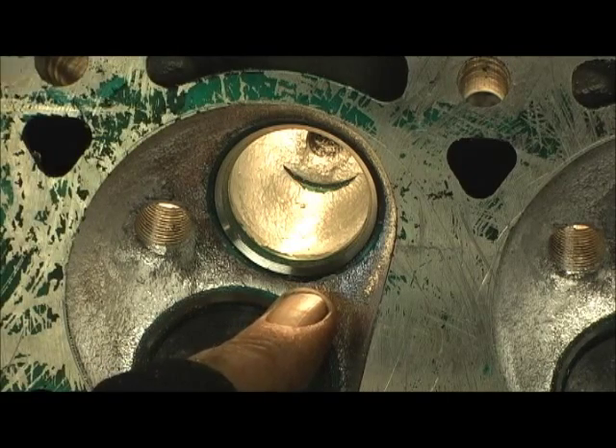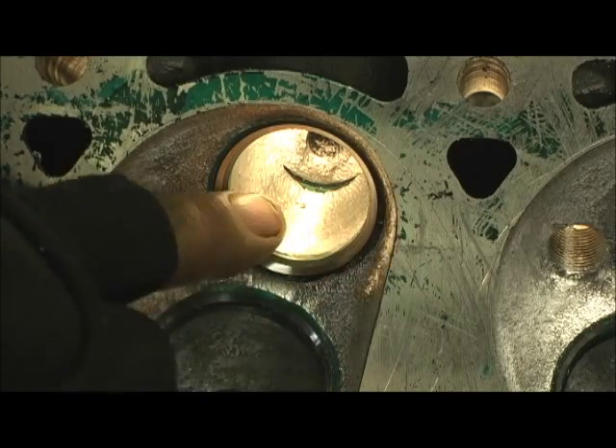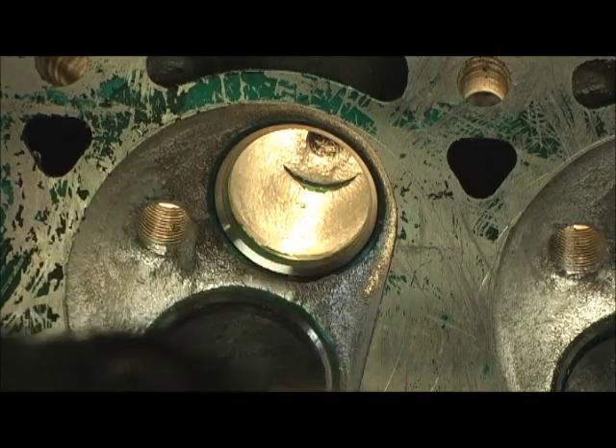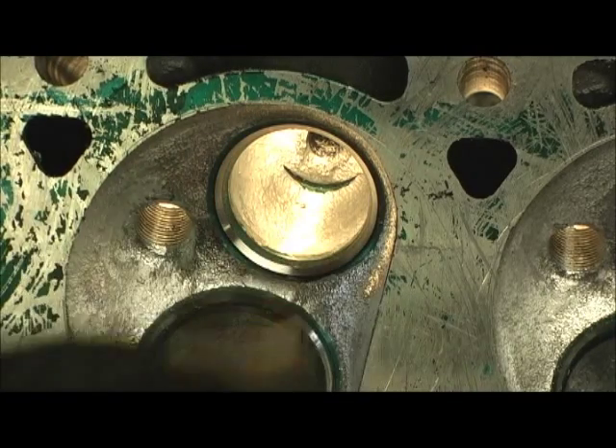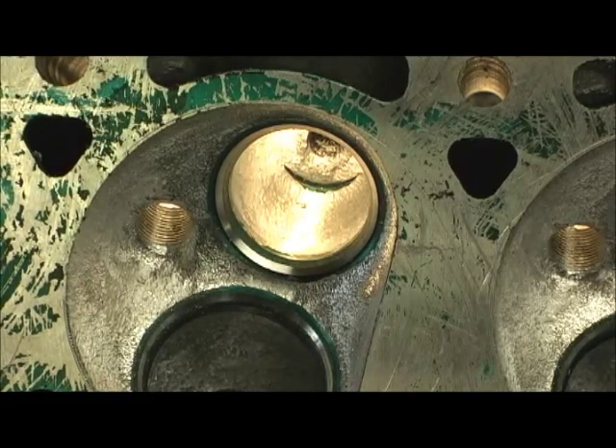I just wanted to go over that big giant wide seat and show you why I'm having to redo the guides and the valve job on the customer's head on a brand new casting. After that, I've got to go back in with a metal bit and cut the excess overhang of the seat and pull it into the 60 degree angle so it'll have a good radius to kick the air out and do what it's supposed to.